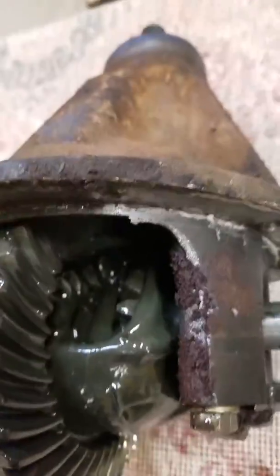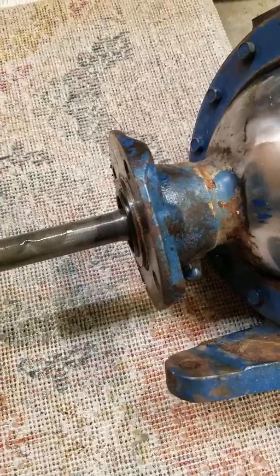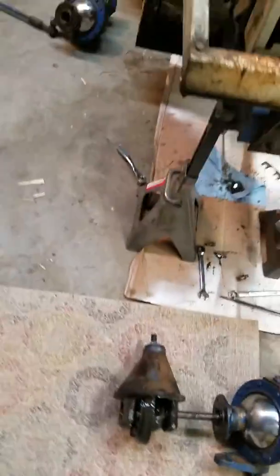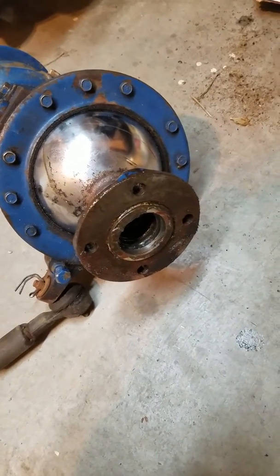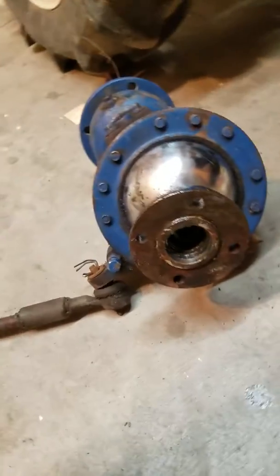In my case, it's all in good shape. The shaft is good on what would be my right side from the front gear shaft. But here's my problem — this is why it's not working. There is no shaft in the left side. So I'm going to need that shaft, at least.